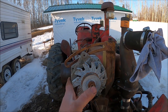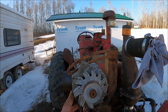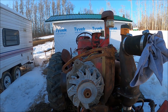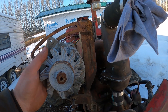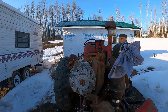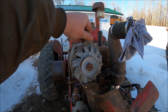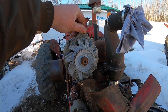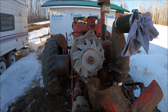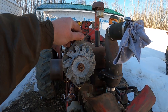I think the bracket itself will be alright, but it's built wrong — they just cut a hole in the side of the hood, and I do care about that. Now this whole thing is out of here. I could tip this in and make it more discreet, and that's what I'll do. That's a lot better now — it'll tighten up somewhat without bothering the hood. That's why I hate alternators on old tractors as a rule — because people gotta butcher them up to put them on and you shouldn't have to. On a four there's not enough room, so I keep the generator.